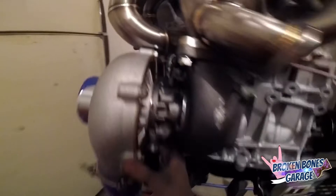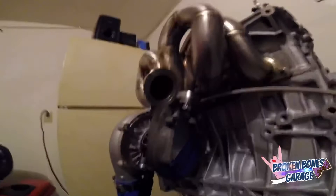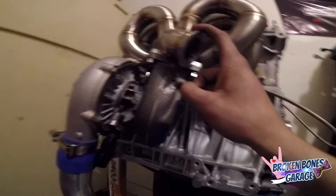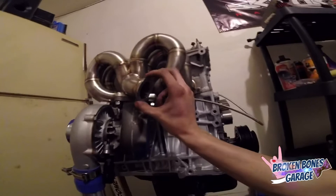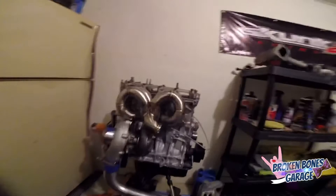It works pretty good. The wastegate — I have to get an adapter. The wastegate I bought for the other crappy manifold over there, it's not V-band. I'm probably just going to leave this V-band just in case I decide to switch later on, but I'm going to get a 44mm to 38mm adapter. The dump tube will either run down here or have some crazy pipe to follow along. Still got a lot to figure out, but overall that's how she looks — looks a million times better.